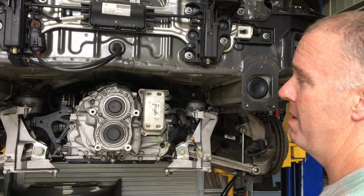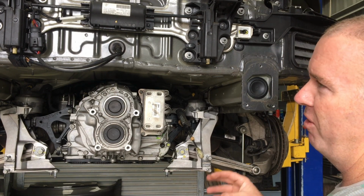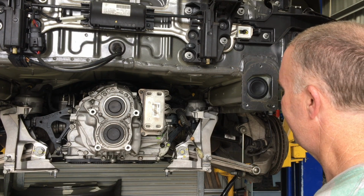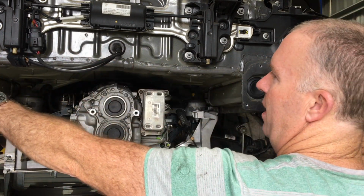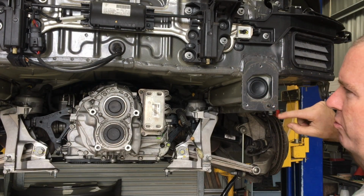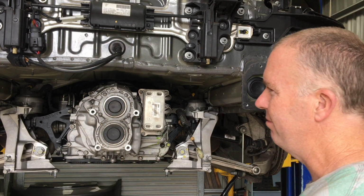Most of this I've already made videos on before, so I'll put links to that in the description, but a few things that I haven't made videos of that are pretty simple I'll just describe now. But things that I've done, I've removed obviously the rear bumper. I've removed the big frame that is behind the bumper here. I haven't made a video on that. It just has 6 M8 screws, 3 on each side that take 23 Newton meters. That just comes off very easily.